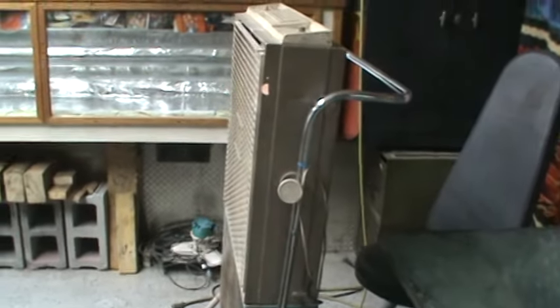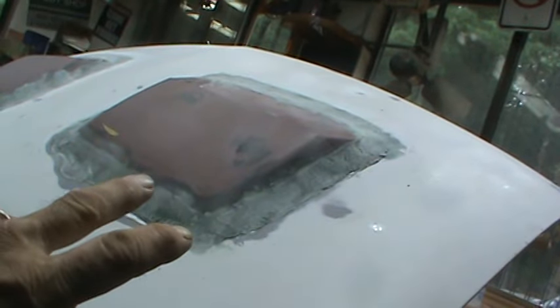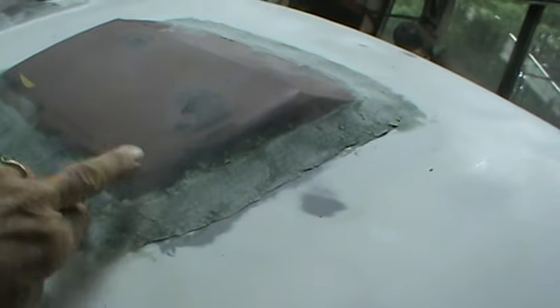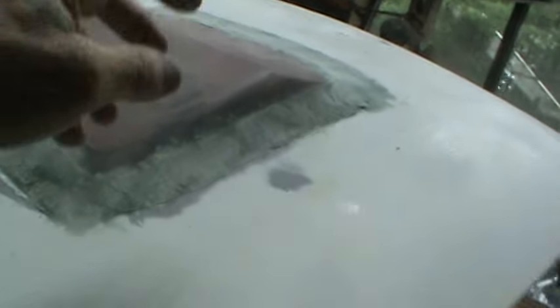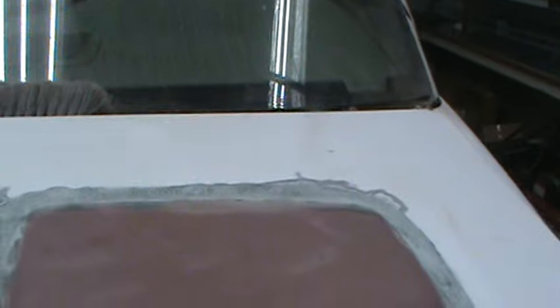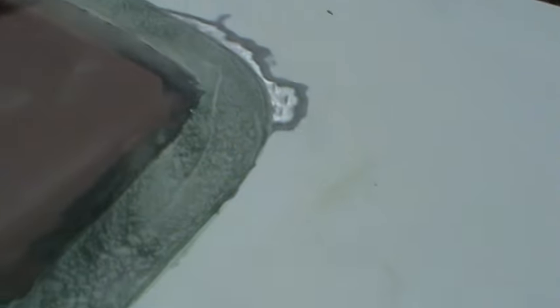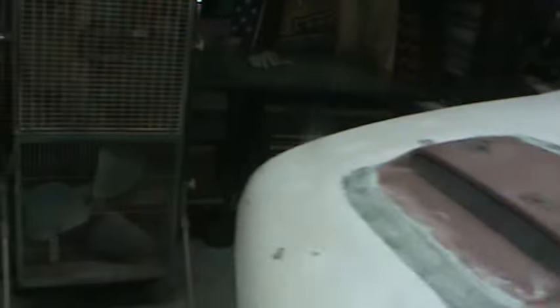Because of what happened with the hood scoops, here's what I did: I took these hood scoops and put Mar-glass tiger hair underneath each hood scoop, bonded bolts through it, then put bolts through it to bolt it down. Then I used the right stuff to bond it down, put one coat of Mar-glass on it, sanded that down, and put another coat on. I'm working on this for the next couple days.